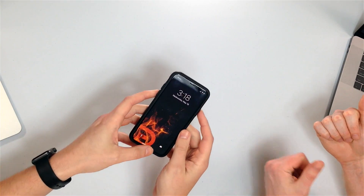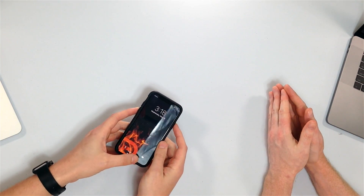First, iPhone 6s and earlier: press and hold the power button and the home button. Keep pressing and holding until the screen turns off and the Apple logo appears. You'll see the Apple logo appear on the screen and then the problem is solved — stop watching this video.